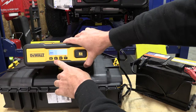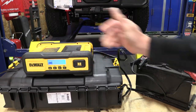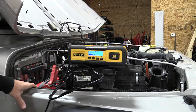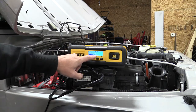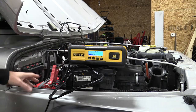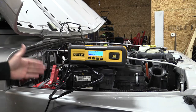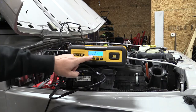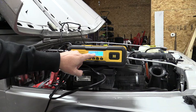The other mode is the engine start mode — let's go over and try that out. I have about a five-year-old Optima red top in this Jeep. While it's showing 12.7 volts, as soon as I hit the key it drops down and will not start. So if we hit engine start it's going to start at 60 seconds and count us down.